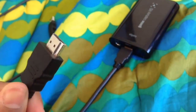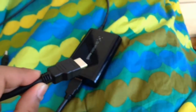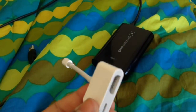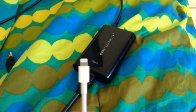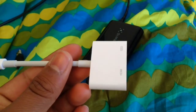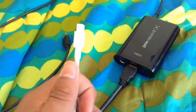So now you have this other HDMI end. Usually if you're recording a PS4 or Xbox or whatever, you would plug this back into the output over there, but that's not the case here. What you're going to want to do is get this special adapter. If you have the old iPad cable you can buy the old version, but I have the newer shorter connector, so I had to buy this one — and it was actually pretty expensive, more expensive than you'd think. It's an HDMI adapter, so you plug the HDMI into the bottom of it, and then you plug the other end into your iOS device that you want to record.